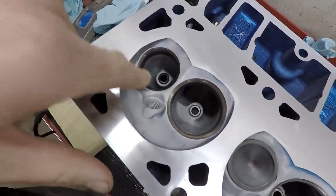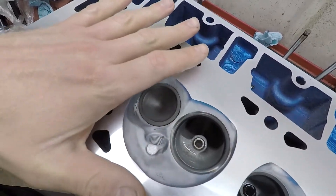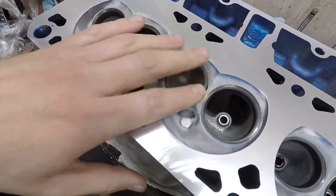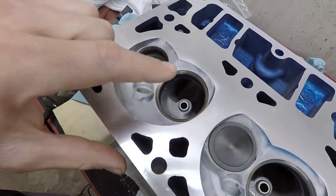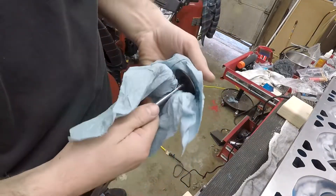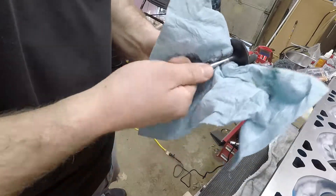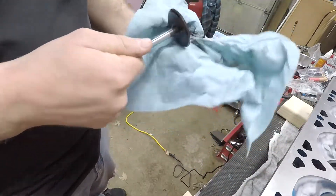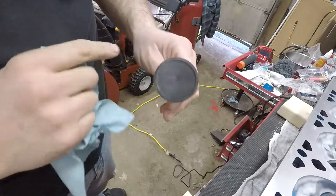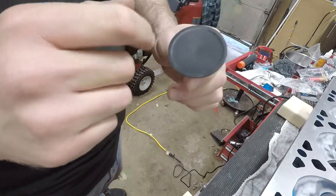The intake is really easy, the exhaust is a little bit more difficult. I also have right here a lapped one that's not quite good enough, so I'll show you what I mean by that. We're gonna go ahead and lap the intake. I have the valves set by set, and this is number seven that I had soaking in some Simple Green — you can use Purple Power or whatever your favorite degreaser — just to get most of the junk off, not all of it, most of it. You'll still have some gunk on the end; some people use a wire brush, sandpaper, or whatever.